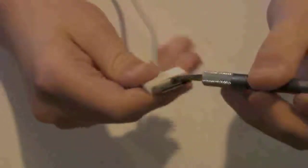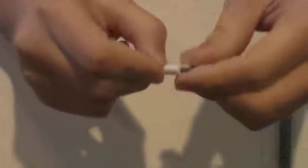Okay, so first of all, there's a little line in between the cable and the dock connector on the cable, and you need an X-Acto knife or another blade. You just stick it in there and wiggle it back and forth, and then if you press from the back with the cable, it might pop up or it might not. Actually, the easier way is to just wiggle sideways with the cable or with the X-Acto knife, and it pops out a little thing. And so if you pull on that, you can remove it, and it's just a little piece of plastic.